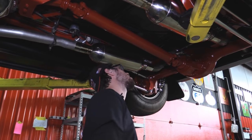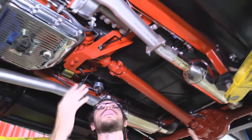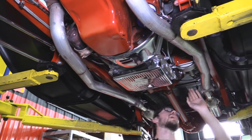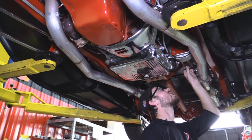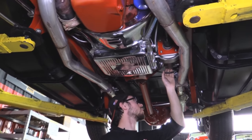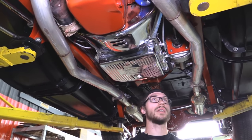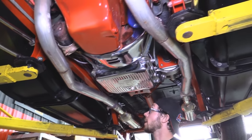This thing does have a functional parking brake — I tested it and it does work. Moving forward, there's a custom driveshaft for the Turbo 350 transmission. It's got a nice chrome pan and doesn't seem to be leaking, which is good because chrome likes to leak. There's a power brake system on the car — drums in the rear and discs up front — with the correct master cylinder for the setup. It looks like an SSBC master cylinder. The brake lines on this thing were done by someone who really cared — the plumbing is done very well with nice right angles.